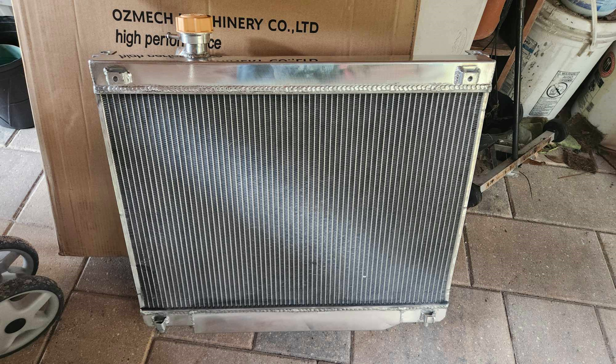Then on top of that, coolant started leaking out of the transmission oil cooler, which definitely was a sign that it was bad. So might as well upgrade it to an aluminum core radiator since we're planning on taking this on Sick Week — and this is actually about the same price as a stock radiator and it's honestly way nicer. The next thing we had to do, since we obviously had an issue with these rusty transmission lines, we just cut out all of the stock lines we could and used transmission oil cooler hose and a flaring tool to flare the stock lines where they were good and not rusted. We ran transmission cooler hose from the new stub ends off the new radiator all the way back to the transmission.